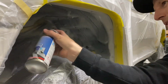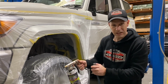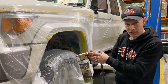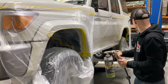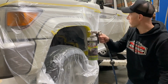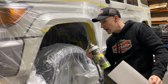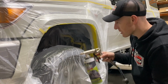We're then going to grab our bully. So we've got our bully liner, we've got our gun. This has got an adjustable pressure here, so you can dial that in. We've got a compressor set on about 80 PSI. This will adjust your PSI anyway, so you can turn it up or down. Now we've got the car masked up, but it's always good to have something, I guess as an eyebrow or a shadow to catch any overspray, because we're going to be shooting out to get on these back faces. But we'll show you how simple it is.